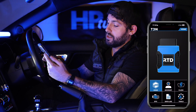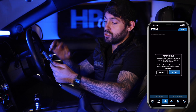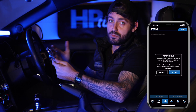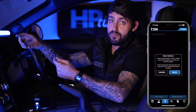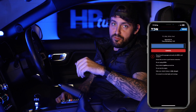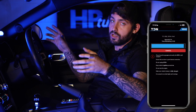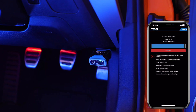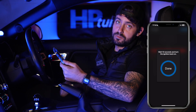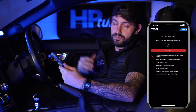Now I'm ready to read my car. Click on Flash and then click Read Vehicle. Once the read has begun, it does its prerequisite checks and initial downloads before moving on to the actual read, where it will give you a time remaining. This can take around 20 minutes, so it's a good idea to make sure your car battery is in good health or put it on charge. Don't worry if anything looks a bit funny with the car — like the lights going off or dash lights coming on — as long as the RTD is flashing away it is reading. Once it reaches completion it will instruct you to turn the ignition off. Click Ready, then wait 10 seconds and turn it back on. Click Done, and it will then save the tune file — this may take a moment but is much quicker than the read.